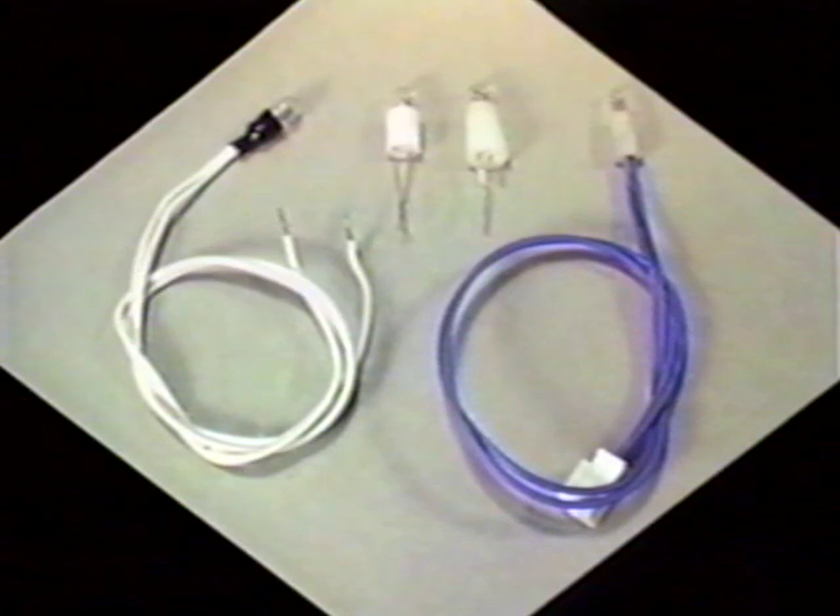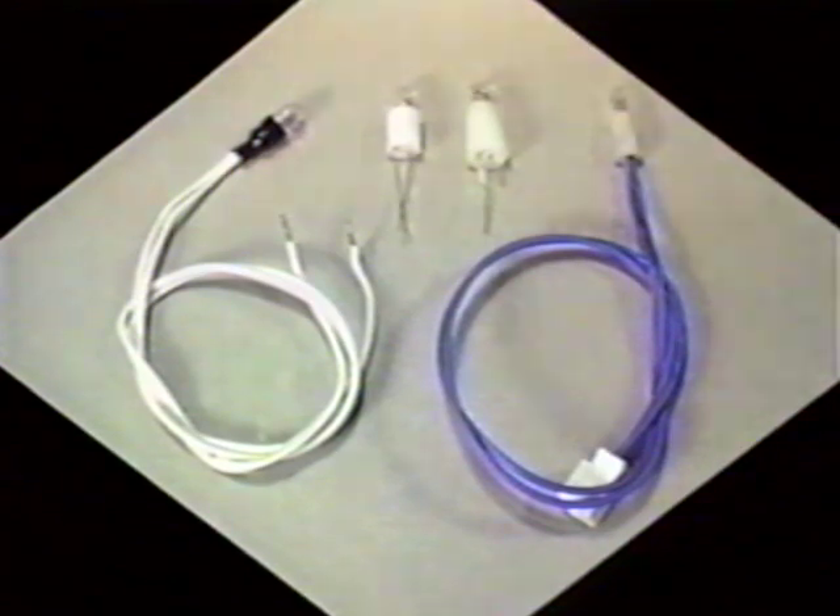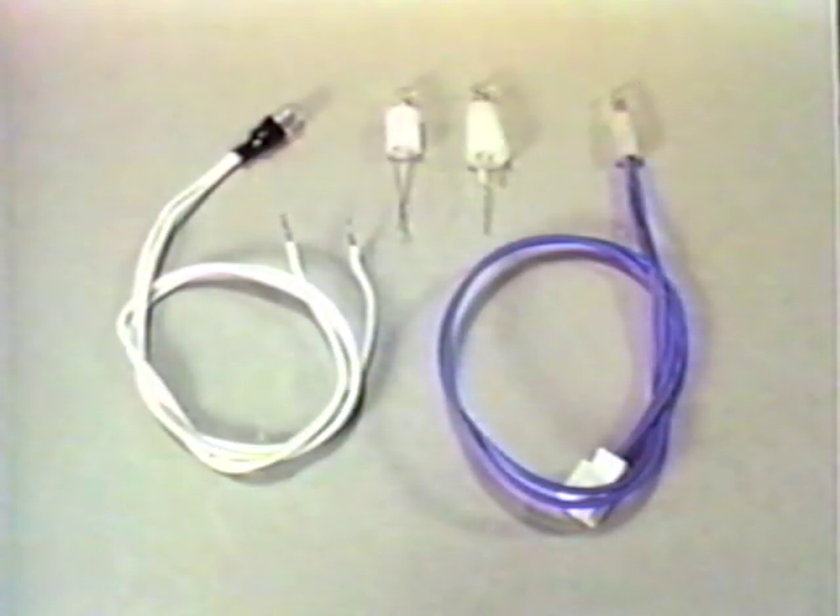Let's go ahead and have a look at some sensor lamps. These are the four most common types found in most VCRs. The one on the right is called a JVC type. The one on the left is a wheat grain — it's available in either 6 or 12 volts. This is a base mount at 6 volts. This is a flange mount, also 6 volts. We're going to show you a couple examples of infrared type sensor lamps, found on the newer models. They do not emit any visible light and usually have a small dome type cover over the bulb. These sensors rarely go bad.